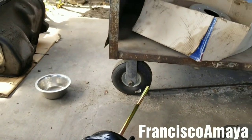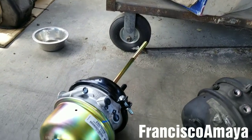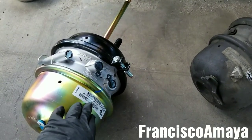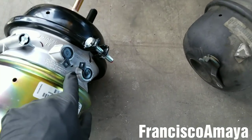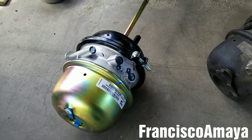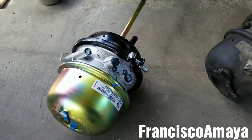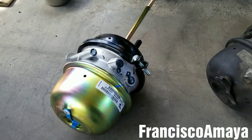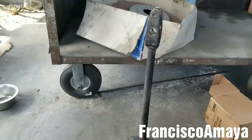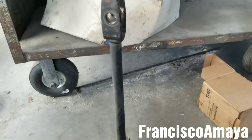This applies whether it is a truck brake chamber or a trailer brake chamber — just make sure the stroke in inches is the same. You can have three inches or 2.5 inches depending on the application. If you install the incorrect one, you will have less braking power every time you apply the brakes.